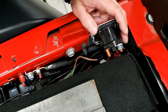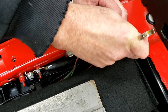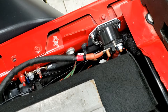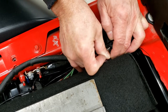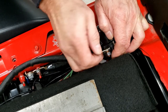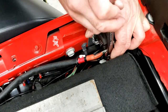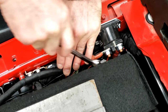These are SAE threads — it's a 5/16 thread so it takes a half-inch wrench. Make sure you get that good and tight. Now here's our cable — the positive battery cable that goes to the winch. Put that on the other switch terminal here with a flat washer and nut. Make sure those are tight.